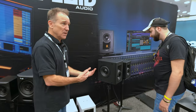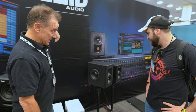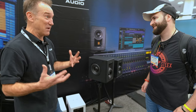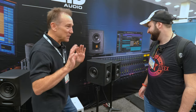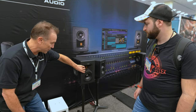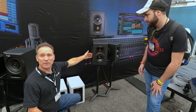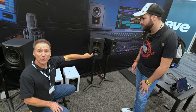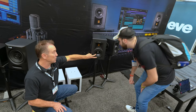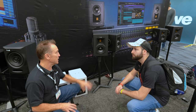Now let's move on to some newer stuff. This is the Image series — our Image 2, which launched this year. It's a big speaker; during development we were calling it 'the beast' because we've never developed anything so big and heavy. The AMT ribbon tweeter is the main selling point — it sits in a horn, pushed back and time-aligned with the mid-range. The mid-range is a 5.25-inch aluminum cone driver with a shorting ring in the magnet structure to minimize distortion.